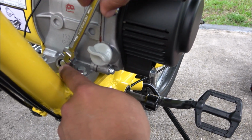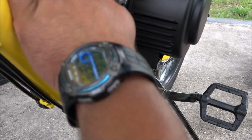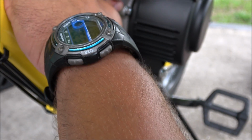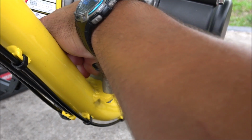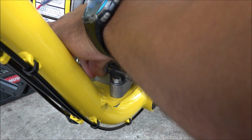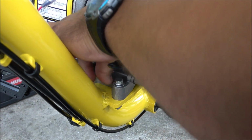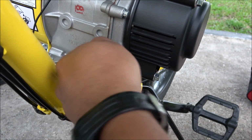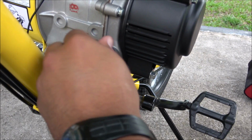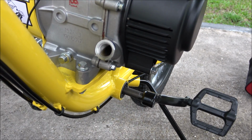And if you have a ratchet style wrench, that'll help quite dramatically. And just loosen that bolt, like so. And then you can take it off with your hands. It is going to get a little messy, so make sure that you have paper towel in handy. And while this is draining, before we remove that bolt, take out the dipstick and set it aside.